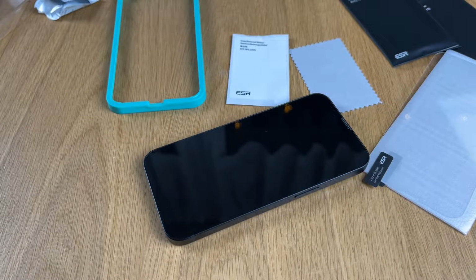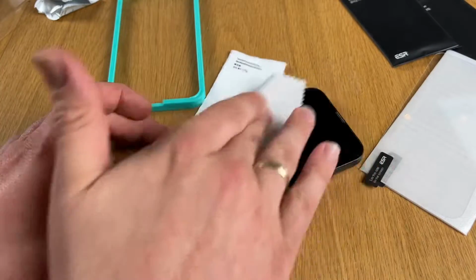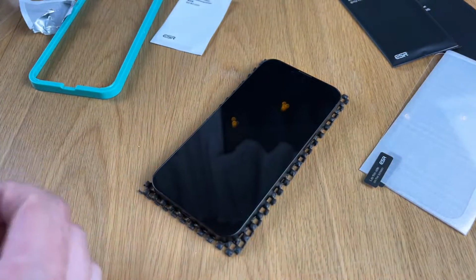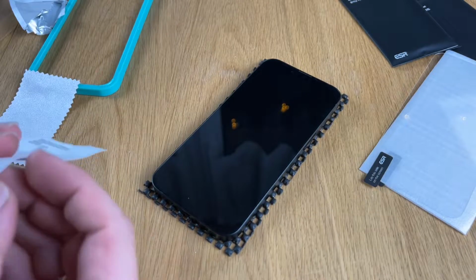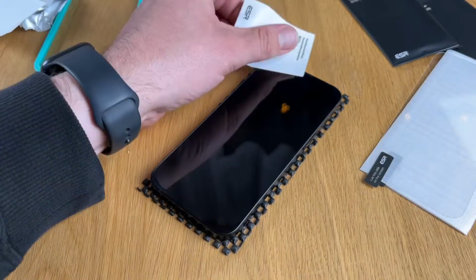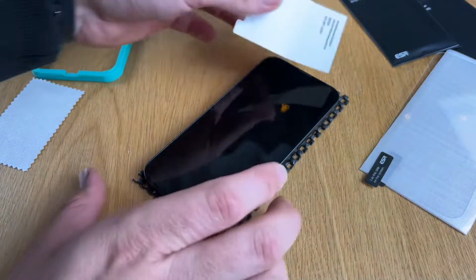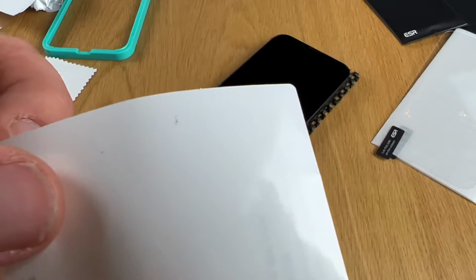The first thing is we have to clean the surface of our screen on the front side with the cleaning kit. After this, we are wiping over it by using the microfiber cloth to dry it out. After this, maybe there are little dirt things on it. You can use the dust removal label. Remove all the dust, all the feathers, whatever. And then it's time to attach the alignment frame. Get the alignment frame on the front side, on the panel, job's done.